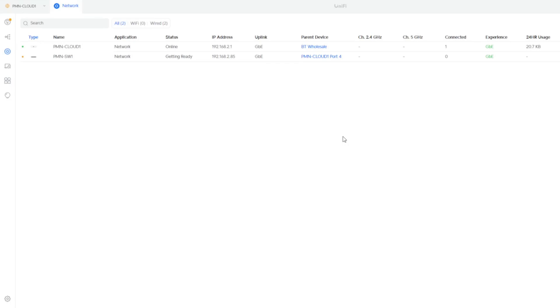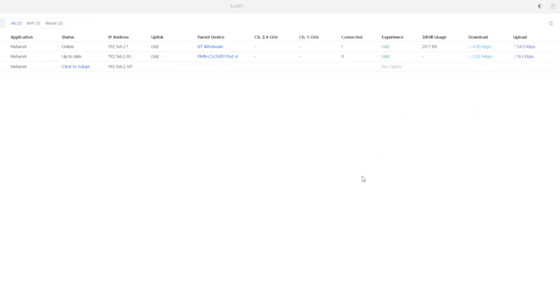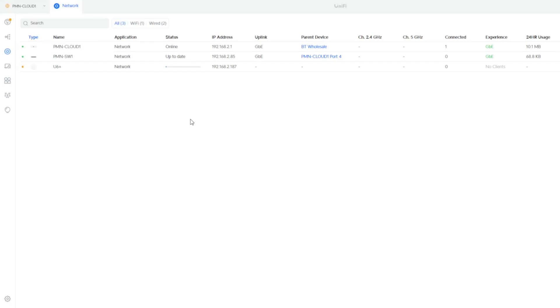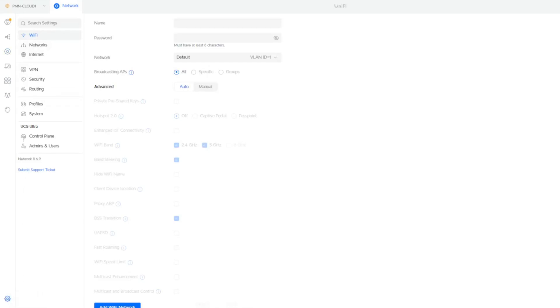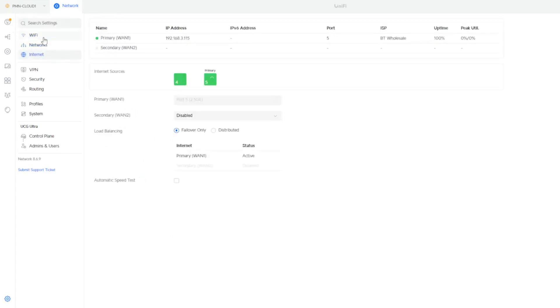Now we set up the Wi-Fi. We get the U6 Plus access point connected, and the new access point appears in the UI. We click add and adopt, and it's now adopted into our UniFi platform. With all three pieces of equipment adopted, we go back into settings to set up the Wi-Fi — giving it a name and password. Because this network is part of the office environment, we assign it to the office network so it only gets IP addresses from that range. We click add Wi-Fi network, and now we have a Wi-Fi network set up, all networks configured, and the connection is ready to be deployed. All the equipment is configured — we just need to get it packed up and installed.